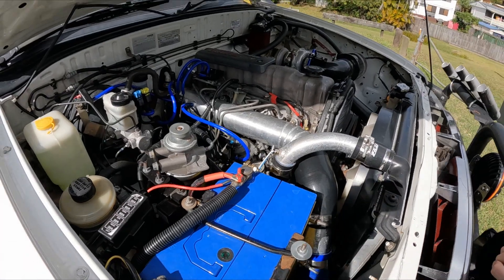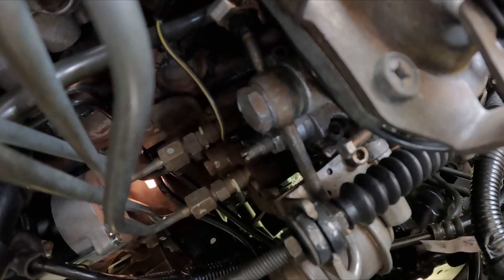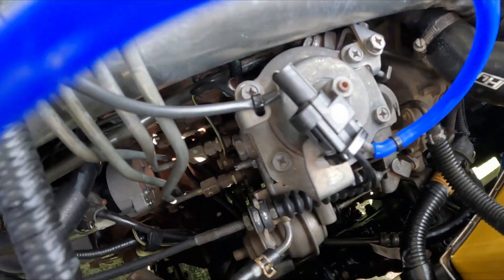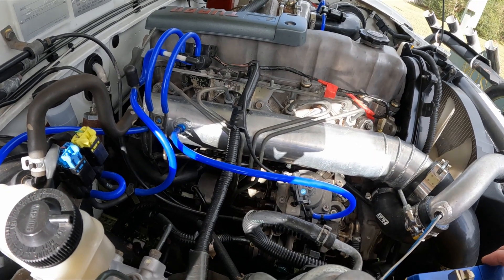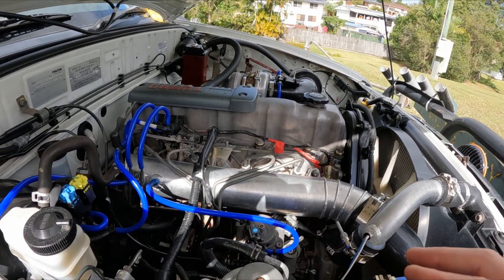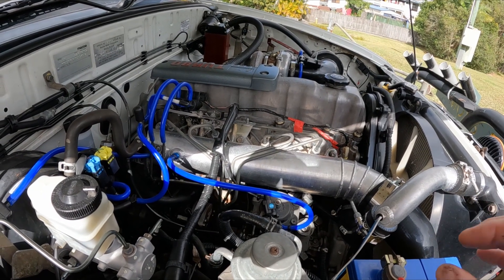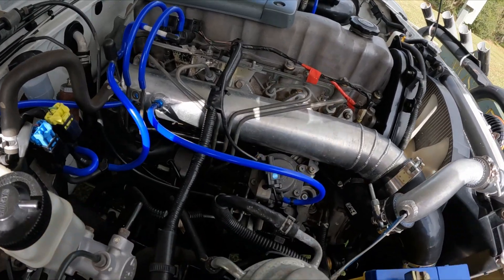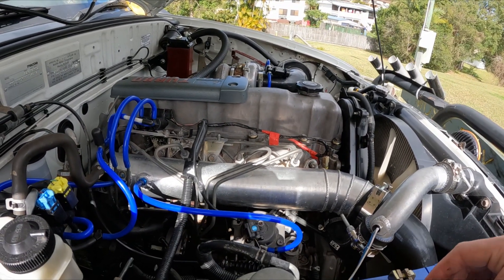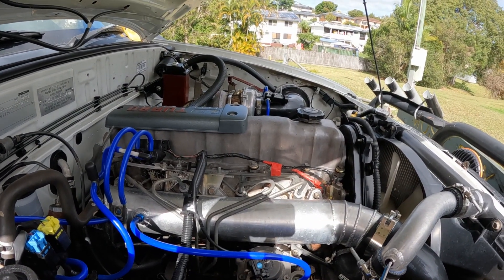Now let's talk about fuel and increasing it. On most mechanical fuel pumps there'll be a governor screw. On the WLT here it's this one — it comes with a metal cap on it that you have to bust off. Then there's a 13mm locking nut and a flat head screw you can generally twist with your fingers. Some people say half a turn or a full turn — I don't subscribe to that. I tune it until it soots when you put your foot to the floor, then back it off a little. My tune is 100% dependent on my exhaust gas temperatures.